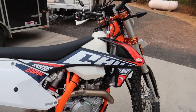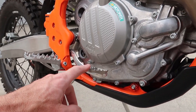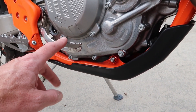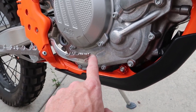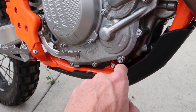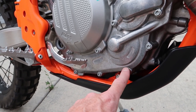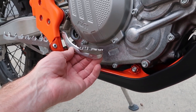There is one thing that is not actually installed on the bike but comes with the kit — it's packaged in with the owner's manual and all the bike information. It's a little snake that connects between the brake pedal and somewhere up here, and what that does is keeps branches and stuff from getting hung up back here, which could potentially bend the brake lever.